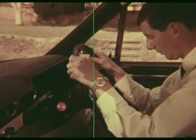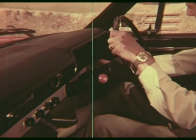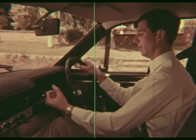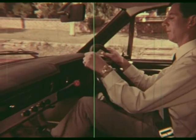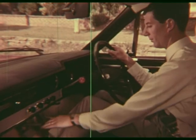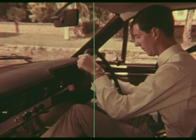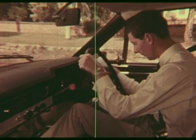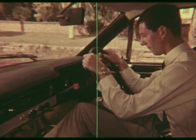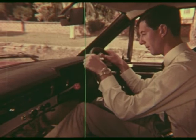If anything looks wrong, we switch off immediately. Some people can check the running of the engine by listening to it, but this comes with experience. We'll run quickly through the drill again: gear lever in neutral, handbrake on, if the engine is cold set the choke, ignition on, check that gauges and warning lights read correctly, then start up. It's bad to rev a cold engine, so we let it run at a fast idle to warm up. As soon as the engine is warm, we push the choke in.